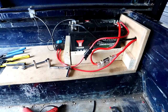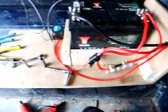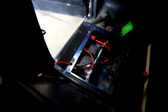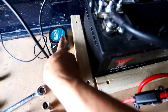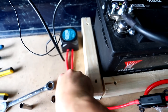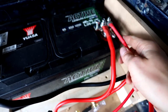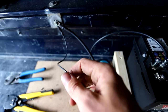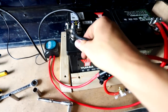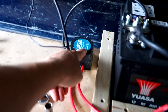I'm done — I think. Haven't tested it yet so it looks like a bit of a mess, but we've got the positive cable coming from the starter battery into the split charge relay, out of that comes another cable into a fuse into the leisure battery. The leisure battery just has a ground going to a ground point, and the split relay is grounded as well. And then these two big wires are the inverter. Let's test it out — there's a little LED there.